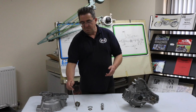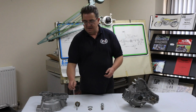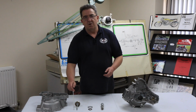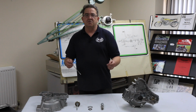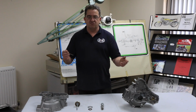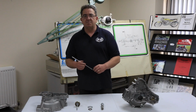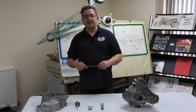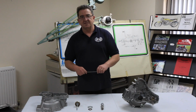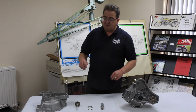Now, I prefer to run at that level, purely one, because I don't need that amount of oil in the engine, and two, in the UK, it allows that oil to get real hot to where it should be. I'd imagine somewhere else, in a hotter part of Europe or in the United States or Australia, you'd most probably want to run with a little bit more oil in there to give yourself a better chance of getting the oil temperature to a sensible level, where the chances are that if you're running in some places it could get very hot. Just think about what you're trying to achieve.